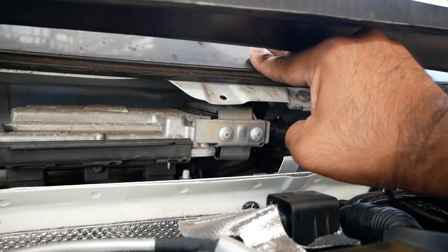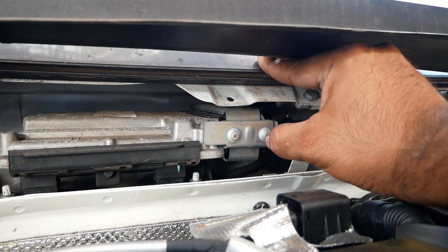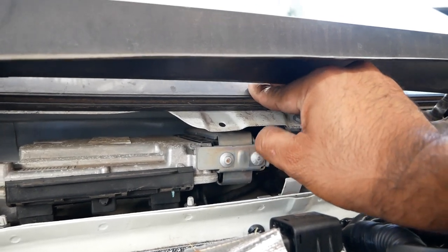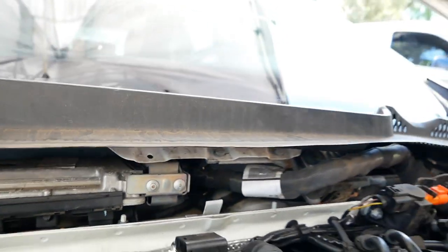See these two? You're gonna need to get a Dremel and cut a slit — grind a slit right down the middle on both of them. What that's gonna let you do is use a flathead screwdriver to break these loose. We'll show you guys that next.